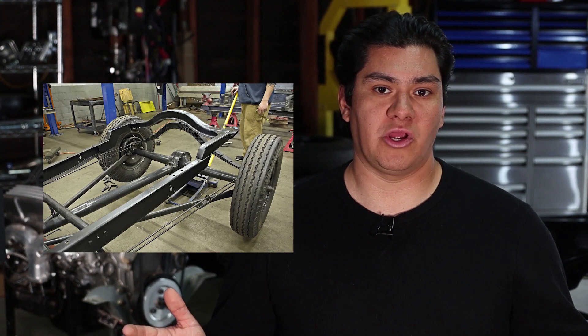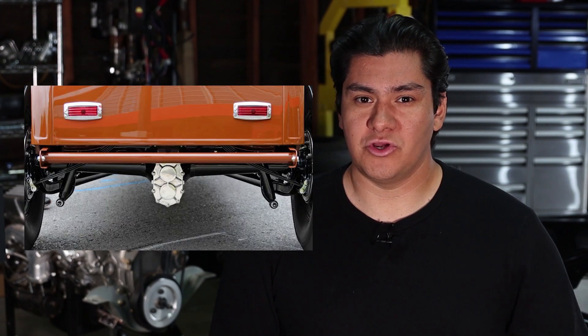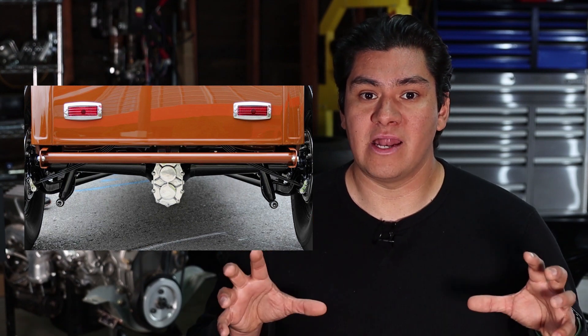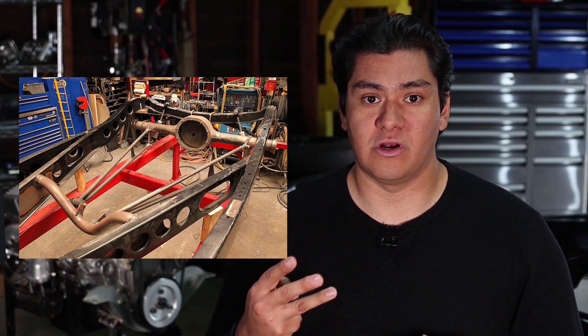Starting with the most traditional approach, that's going to be what they call the buggy rear leaf spring, and then you use gas-filled shocks. That is definitely the most traditional approach — it looks beautiful, especially if you're running a really nice rear end like a Winters Quick Change. For the rear buggy springs, you can hold your rear end in a few different ways. The most traditional approach is your original wishbone, which comes straight from the axle and meets in the center. Then you have your split wishbones, and from there you have your ladder bar — those are your three critical options.